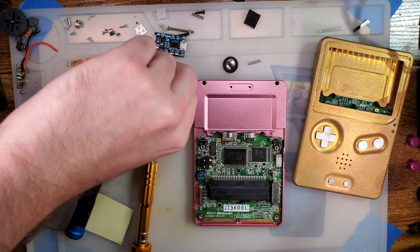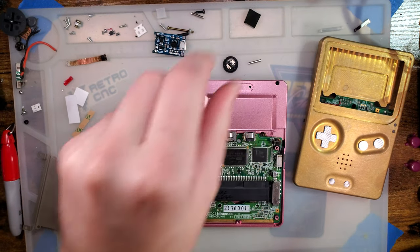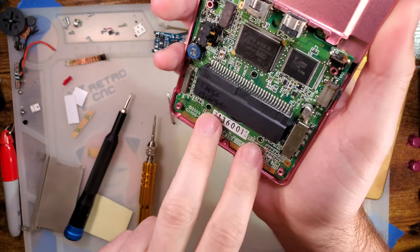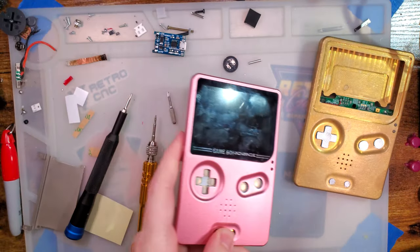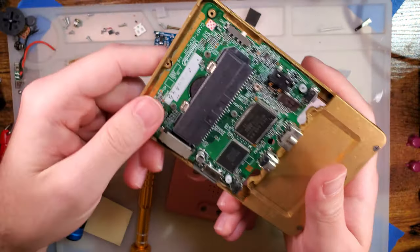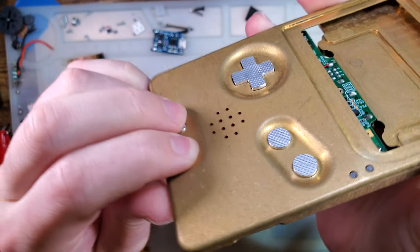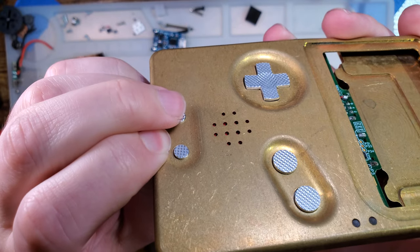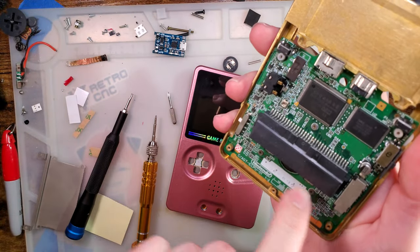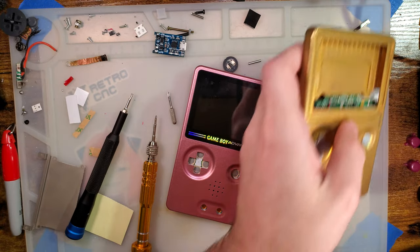A lot of people don't spend nearly as much time as I do with a screwdriver in their hand, so what seems intuitive to me when it comes to screws is not exactly intuitive to everyone else. And while we're talking about screws — these two bottom ones plus the cart slot screw, if these are all too tight, your start and select buttons are going to feel like absolute garbage. If I come in from behind and push on the motherboard to put it where it's supposed to be, you can see the buttons are sticking out quite a bit more. Pay attention to these three motherboard screws and this cart slot screw — it might take a little bit of tuning to get it exactly how you want it.